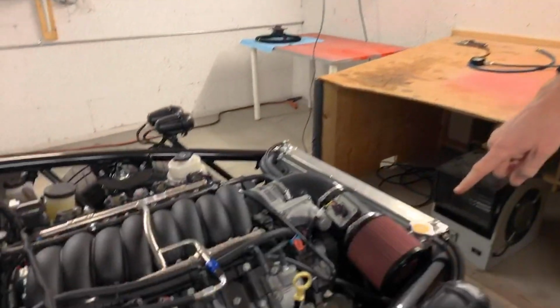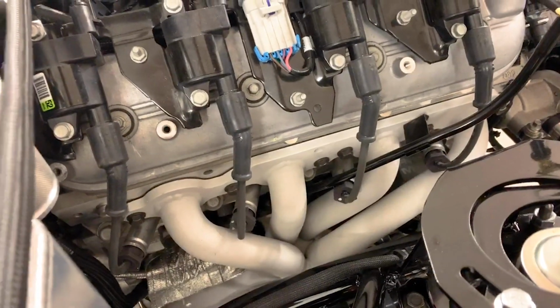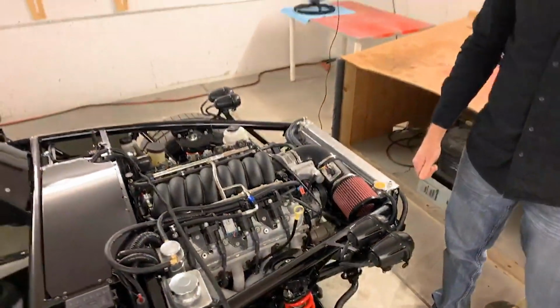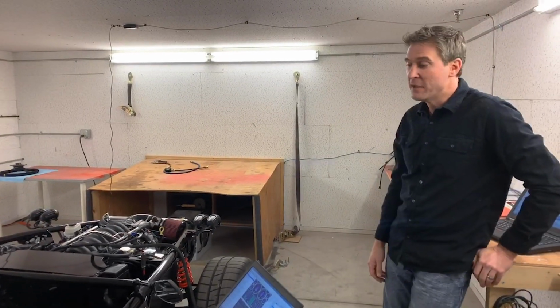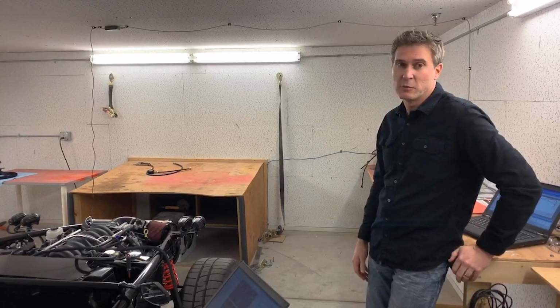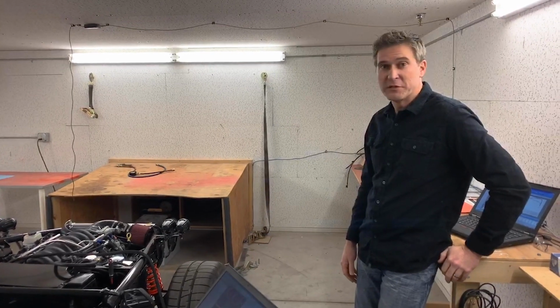What we like about these is a traditional ceramic coating is about 4 to 6 thousandths thick. These Swain coatings are 20 to 24 thousandths thick, give or take. They're really thick, really hardy. In our opinion, it's the best ceramic coating that we've tried in years of trying lots of different options. So, as an option, that heat mitigation on the V8s is definitely a thing. So anything you can do to try to keep heat coming up into the floorboards is definitely worth it in the long run. So, 6.2 liters of power.